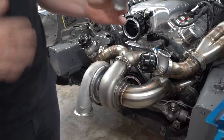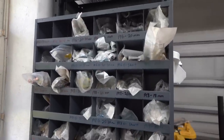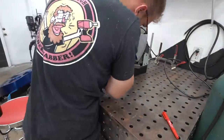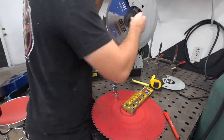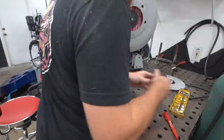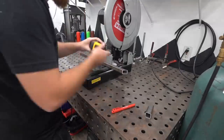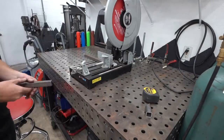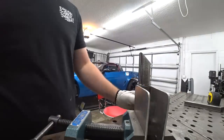We also need socket head M8 allen bolts, which I somehow don't have. After taking measurements with the mount in place, we had to cut it a little short because the steering rack was in the way — we couldn't go all the way to the subframe and straight down. Getting the length of a 45-degree cut right is always tricky. We swapped to the steel saw blade, got our first piece cut, being really methodical since we don't have a ton of extra material. We got our 45 and our support piece cut and tacked the first piece to the mount.